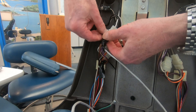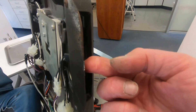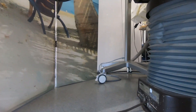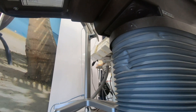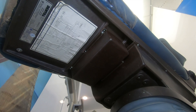I'm doing it with WAGO connectors, which work out really well. Now I'm just going to raise the chair to give myself a little bit of clearance to work underneath — it's going to be a lot easier when the chair is raised up. As the camera moves towards the back, you'll be able to see the wiring diagram underneath the chair, which they don't really provide anymore, but it shows you exactly which wire controls which motion. I just need to get that box off and that's it.